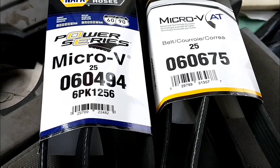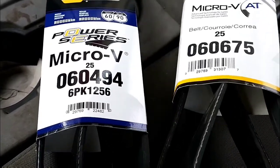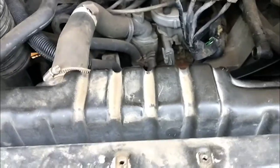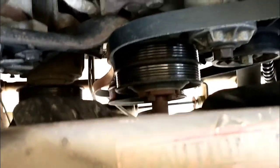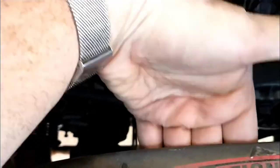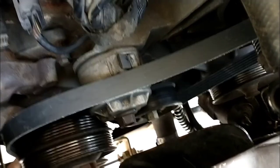On the Econoline 350 — this is the belt you need. The bigger belt here is the main belt, and this is the accessory belt. I'm back with the new belts and I'm threading them in there now. You have to crawl under and put it around the fan — you don't have to remove the shroud, just go right inside and work it around. It's just a matter of threading it through all the various pulleys in the correct order.